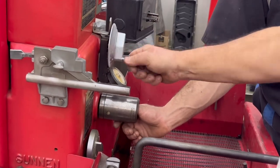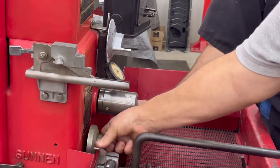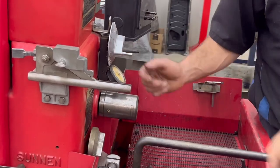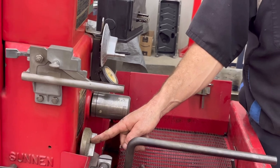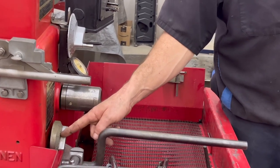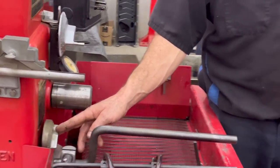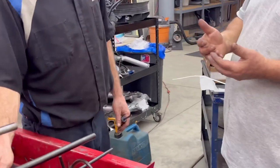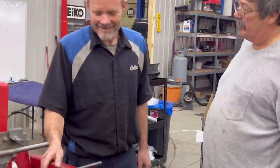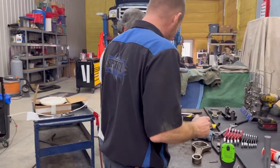Okay, so that's the movement. This is the spring tension. So that's going to really adjust size, and that's going to adjust how fast I get there? No, that's just going to adjust the spring tension behind the mandrel, not how fast. It has nothing to do with speed, but if you don't have enough pressure, you're pissing in the wind. If you have too much pressure, you're breaking something down or not doing the job correctly. I have to get a feel for how hard is the hardest you can do and still be productive.